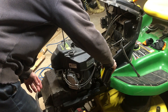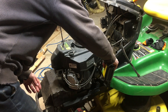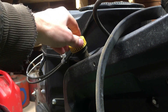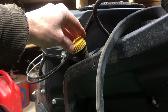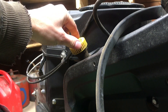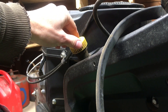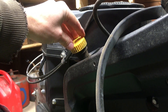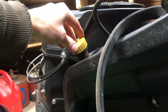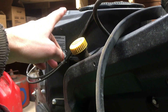Refilling with oil, I do the first quart and a half or so pretty quickly and then I start to check with the dipstick just to make sure I'm not going to overfill it. For checking the oil, you don't screw the dipstick in — you're supposed to rest it on top of the threads. What I usually do is spin it counterclockwise, the loosen direction, until it drops down — you go backwards, it raises up, and then there's a point where it falls back down, and I check it right there.